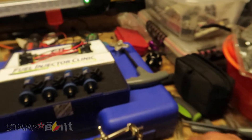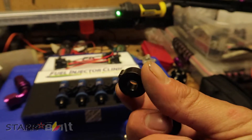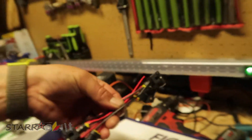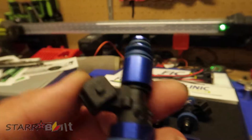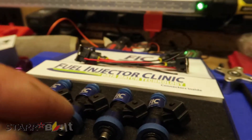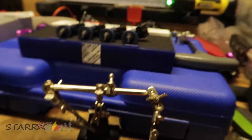Everything's sitting over here because I had to go to the junkyard and get these little spacers for the fuel rail. But yeah, we're going to install that right now. Those do come with pigtails that I actually have to wire in — another thing, if you watched the video, I made my own harness. So I have to cut those and solder those back in. What you're going to want to do when you first get these open is grease those O-rings and then a little bit around the bottom base O-ring. I just put a little bit of grease in those big openings — I used regular assembly lube, it worked fine. A small amount will do you.